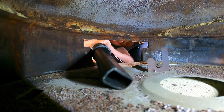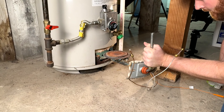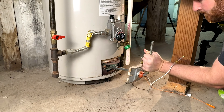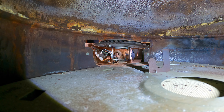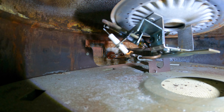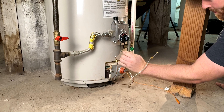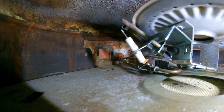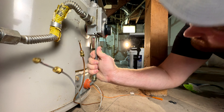Now I'm just going to clean this real quick before I put the burner assembly back in. When you go to put your burner assembly back in, make sure you pop a wheelie so that you can set the tube in that bracket. It can be a little fussy, but it'll eventually set in there real nice. Once that's in place, stick your main tube back in the control valve and tighten up the nut.